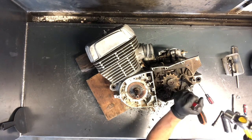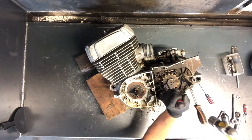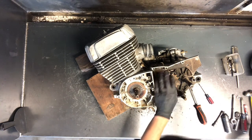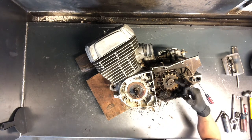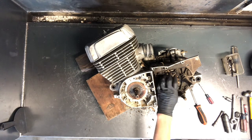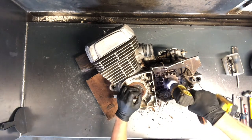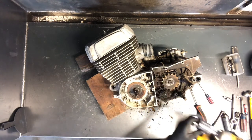Countershaft sprocket here — it's got a flat keeper on here. You flatten that out. This is an inch and a quarter socket to pull this off. These are a little bit challenging because you hate to get your fingers stuck in there spinning it. In this case we're stuck in gear so we're able to just spin it off there without holding it. Otherwise I'd suggest putting something large in there to cause this from spinning — you don't want this to spin while you're pulling this.